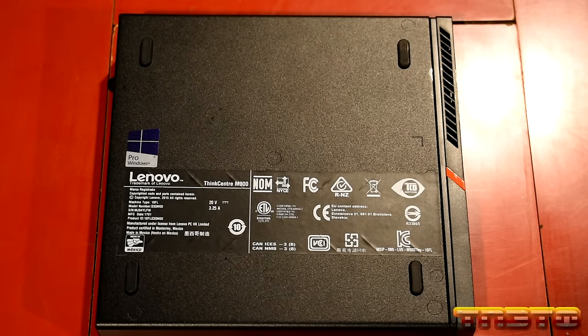Now this will take 24-hour time. So when you enter these in, if you're in the U.S., you're used to 12-hour time. So if it's 1 o'clock, it'd be 13 o'clock, okay? So let me go ahead and look at my phone, and we'll get this updated. So the time is 12:51. I'm in luck. The date is 12:15, 2022. We'll hit escape. No, we want to save. Go over to exit, save changes and exit. Yes. Okay, so I just updated the date and time. So now it's not saying it's 2015 because it's not 2015. The unit will reboot.